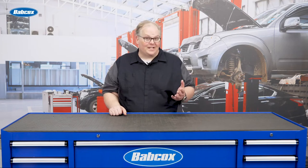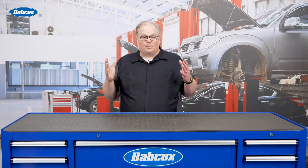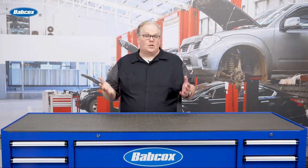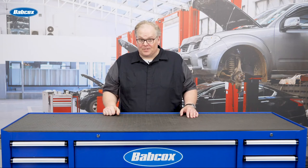This can result in a condition where you get camshaft rattle. So make sure that you're replacing all of the gaskets when you service the Vanos system or even remove the valve cover in some cases. I'm Andrew Markell. Thank you very much.